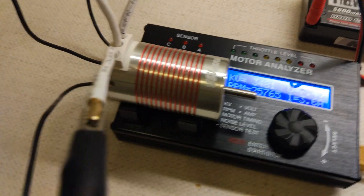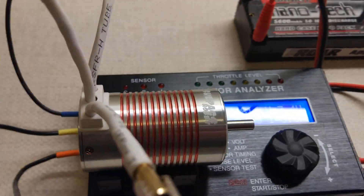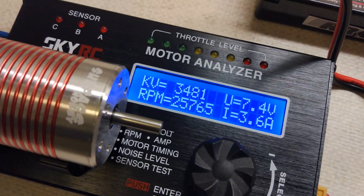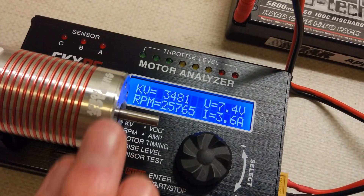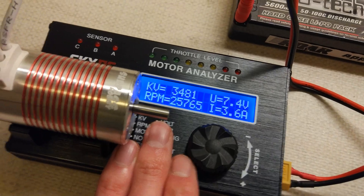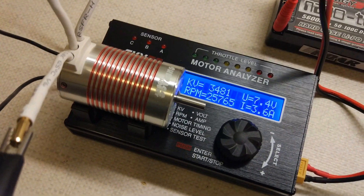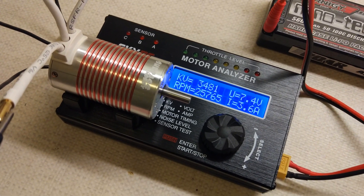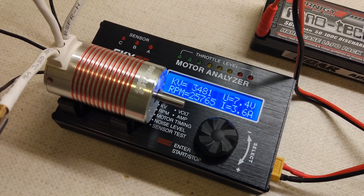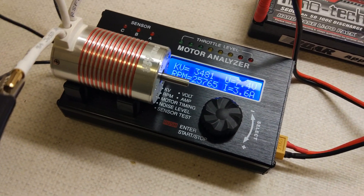It's clearly nowhere near 3800KV. Just so you know, it's the right motor — everything says so on the back. It's a bit lower than expected, but because we've got the KV tester we can compensate for that with the gearing, so that's fine. 3800KV is quite high for a 1/10 scale monster truck anyway. This will be getting tested in the Team Magic and hopefully in the next video you'll see it doing a run. Goodbye.